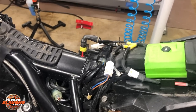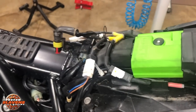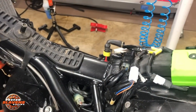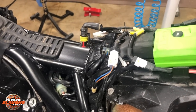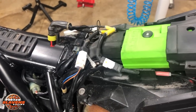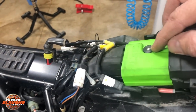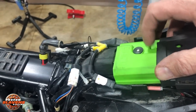Remove your tank and seat. I've got the side panel off here also just so I can show you the Gett Wi-Fi comm, which I'll get to in a minute. You do have to pull the tank to put the wiring harness in for the Gett map switch. This part right here is called a baro sensor, or barometric sensor.